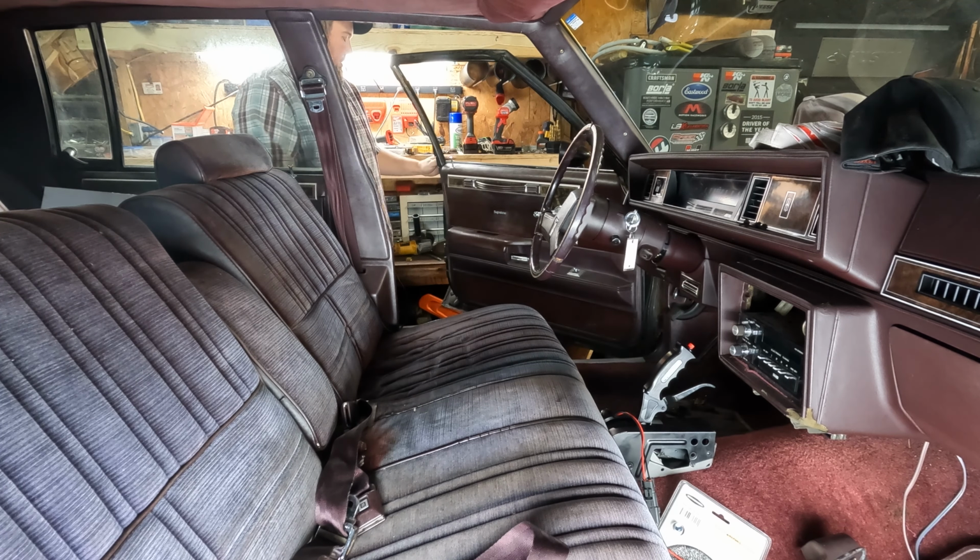Oh, so much better. So this is gonna work out great, but we need a turn signal. That's where this comes in. So we have to start with this column collar. This gives the turn signal switch something to grab hold of. And of course these are Allens, and I don't have an Allen. So how do you sort your Allen keys? Got them. So we put the collar around the steering shaft. We'll leave that loose, open this guy up.